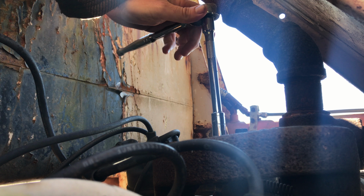Remove the air intake, and then on the other side, you've got your throttle right underneath there, and the spring right above the throttle is just to keep the throttle in place when you're not pushing the gas pedal. So I'm going to take this out, and in order to get the carburetor out, you will need to remove that manifold. So have a set of manifold gaskets available, and we'll take apart that carburetor, take a look inside, and see if we can't clean that out.